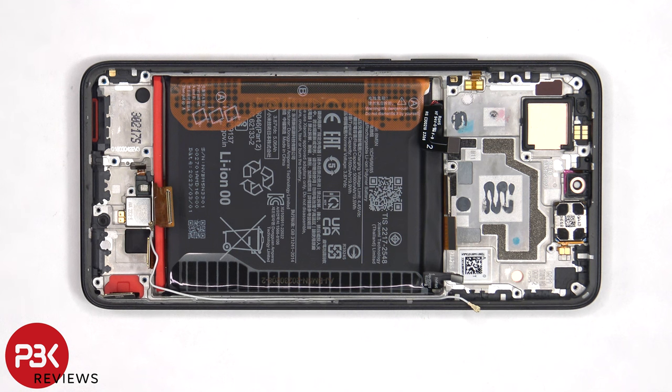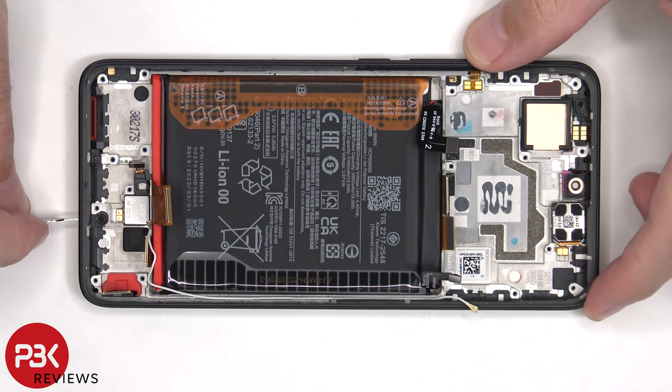For anyone who's worried about puncturing the microphone or the filter for the microphone by placing the SIM ejector tool in the wrong hole, you won't need to worry since both the filter for the microphone and the microphone itself are seated above the hole, so it's like an L shape or a 90 degree turn, so the SIM ejector tool won't actually reach them to damage them.